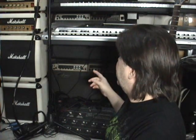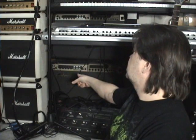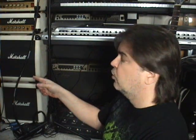So it is in stereo, it has two amps in here. It's not just one amplifier, it has two totally independent, separate amplifiers. So I am putting 75 watts RMS through that speaker, and 75 watts RMS through that speaker while they are at 8 ohms. Now when I bump this down to 4 ohms by adding another 8 ohm speaker or another 8 ohm load, they call it a load because that's what it is. You are loading the output jack with another 8 ohm load.